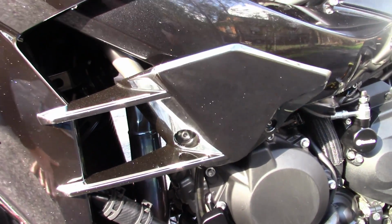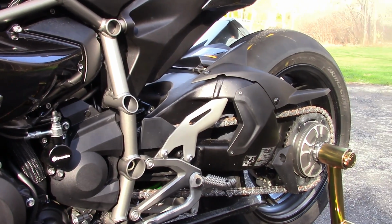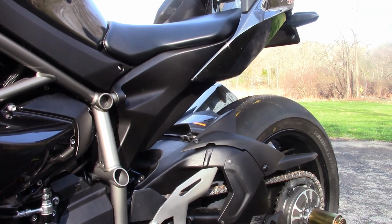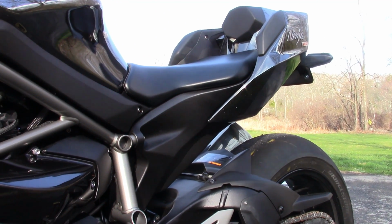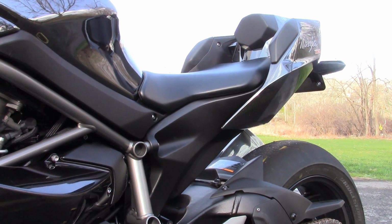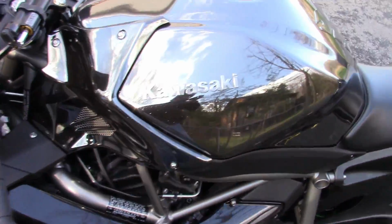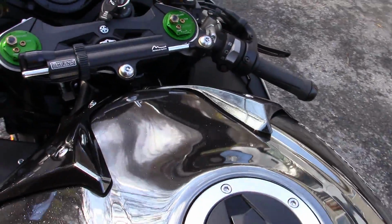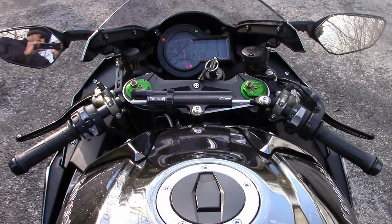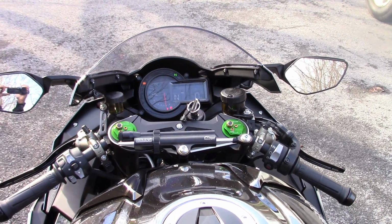There may be other things, for those of you watching, maybe you would have styled it differently. But the styling, everybody has their own personal preferences. One thing though that it doesn't have is a belly pan, and that's extra insurance, especially when you're doing track days. You don't want to have your oil filter come loose or oil drain plug kind of back out and oil the track. Being able to have that oil catch pan is nice to have.